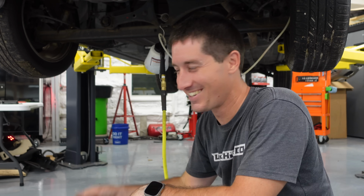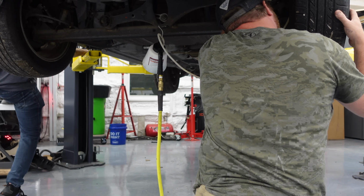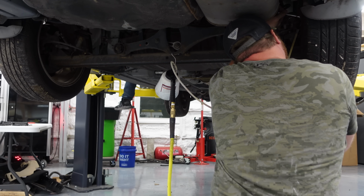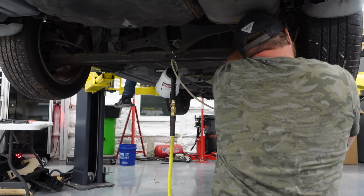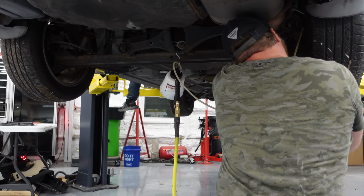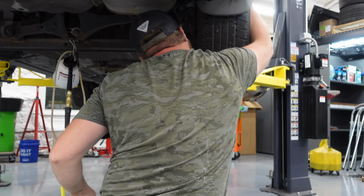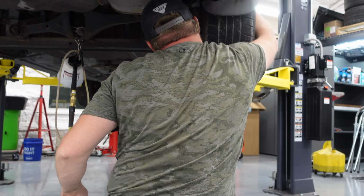All right, let's bleed these brakes. Did you open it back up? No, it should be closed right now, and I'll give you full pressure and then crack it. Okay, go. Close. Closed. No, I don't see any air. I got pressure. Go one more time. Holding. Close. Okay, it's closed. Does it feel like it's releasing properly? Yeah.